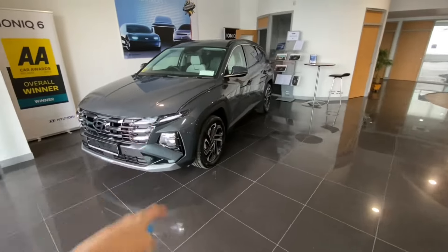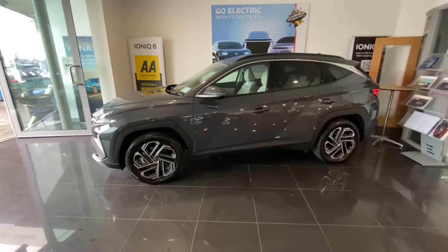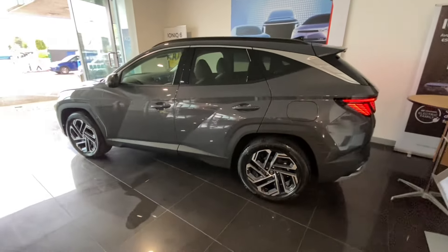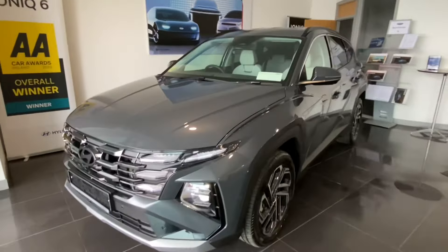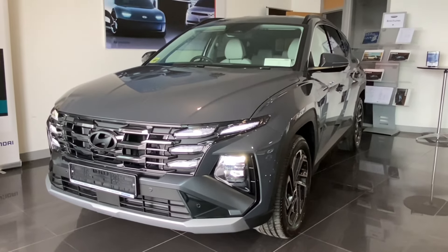This is actually a customer's car so I don't want to drive it extensively on the road, and I don't have another plug-in to test drive right now. But hopefully that gives you a good idea: two different modes — eco mode uses the paddles for regenerative braking, and sport mode uses them for manual gear changes. That's how the paddle shifters work on the Tucson plug-in hybrid, and it's exactly the same on the new 2024 Santa Fe as well.